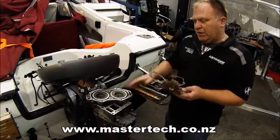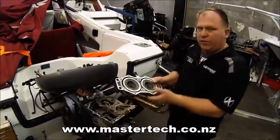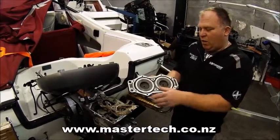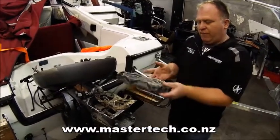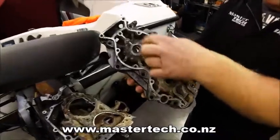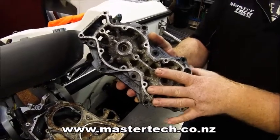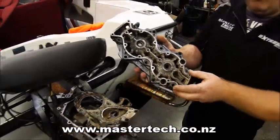On this particular engine, this cylinder head has been cleaned up. Here is an example of the surface being all cleaned and ready to go. But on the flip side, we can see where there has been salt build up. Some of this has already been cleaned out, but this is the preventative maintenance that needs to be done to ensure reliability.